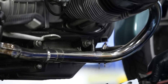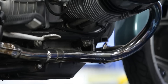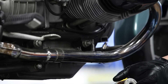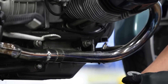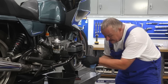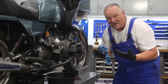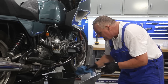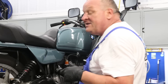Always when you pull the filter out, make sure that the rubber seals came out also. There's a rubber seal missing — it fell off in the oil pan — but they do come off. If that seal were left inside and you put the new oil filter in, you'll potentially crush the oil filter and lose oil pressure, which would be terrible. I'm going to move along and get the rest of the oils draining. The gearbox is the next one we're going to drain.